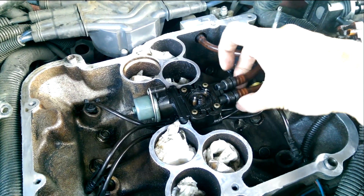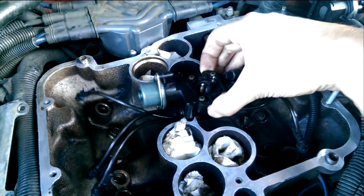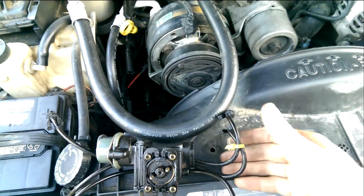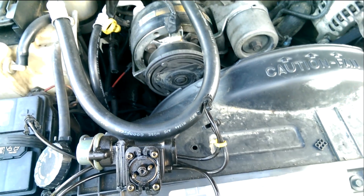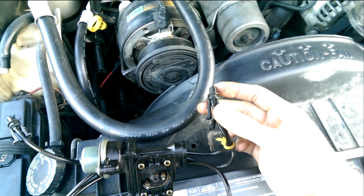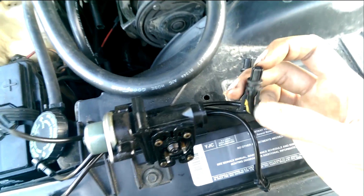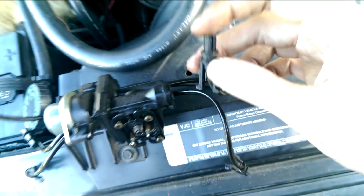There's just a data cable — once you get the little poppets pulled out, this unit just slides right out. What I noticed was when I still had the fuel lines plugged in, I pulled out the fifth cylinder poppet and had somebody turn the key on — not to start it, just so the fuel pump ran. I noticed that when the fuel injector was pressurized, this poppet immediately began leaking and drained off all the pressure, directly, without even trying to start the car. My first suspect was that this poppet was blocked or clogged open, because those can sometimes tend to do that.